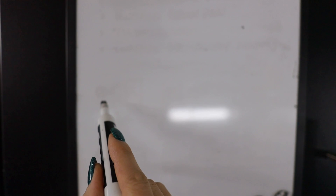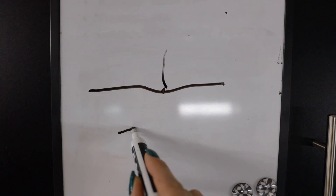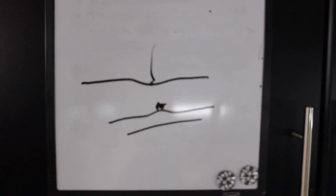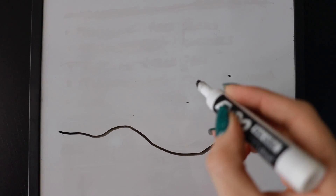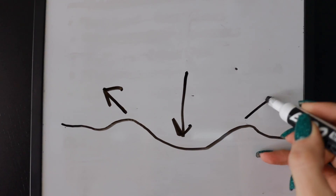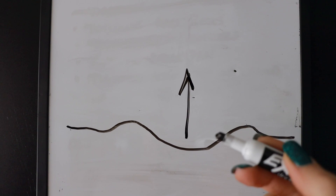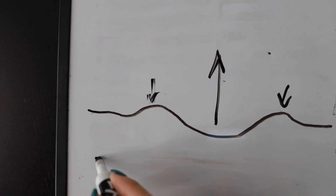I've noticed a couple different types of dents. The ones on a flat surface are a lot easier to pull — you attach the glue and pull upward, and you might get a little outward pimple that you just tap down with the hammer until it's flat. The problem is most dents aren't on perfectly flat surfaces. The dent dude taught me a trick: on curved areas, dents often have a crater effect where the metal gets pushed inward in the center but forced outward on the edges. So you pull outward on the center dent, then tap down the outer edges — that puts tension back in the center and makes the metal more rigid.